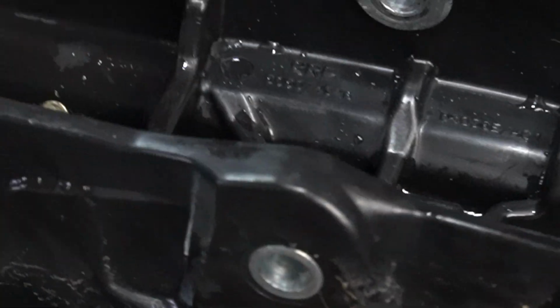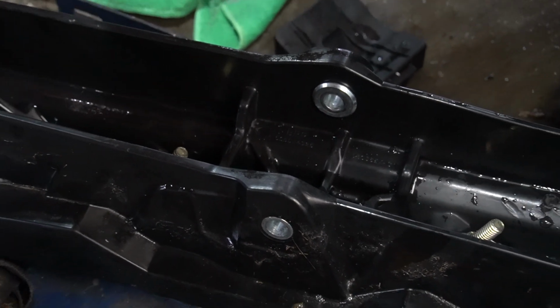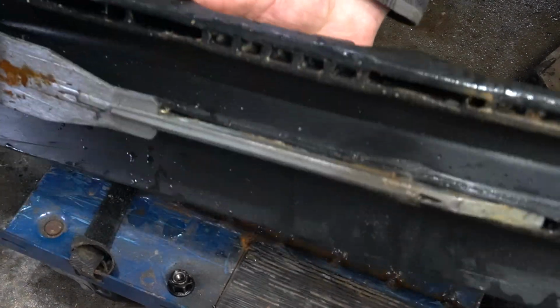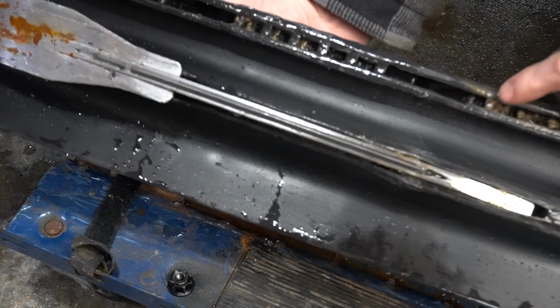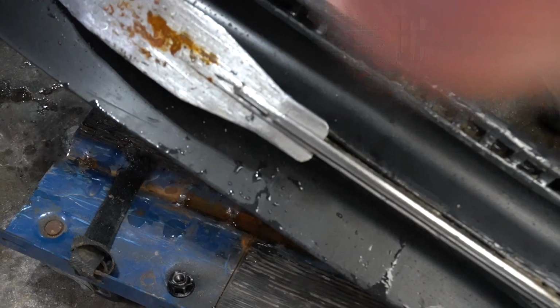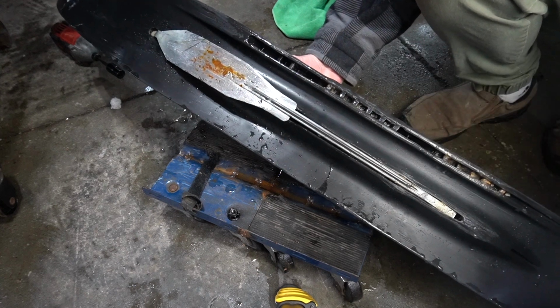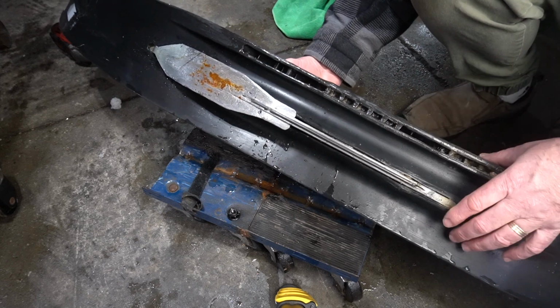And I just want to point out another misnomer that you see online, is that some people say the right and left ski is the same thing. It's not the same ski, because if you look at the ski, there's an extra keel here for an outside carbide. I'm running the Quality Pieces adventure carbide on here, so I'm not running the outer carbide. Look at the keel on here. It would really dramatically affect the handling. So there is a right and a left ski on this.